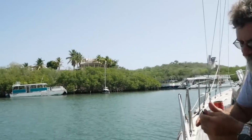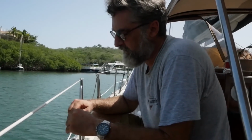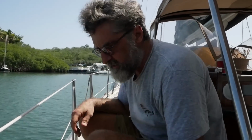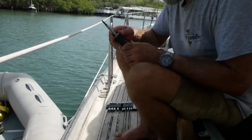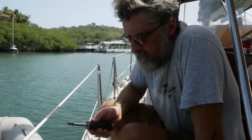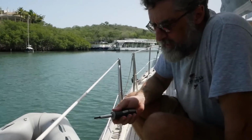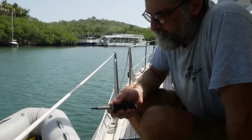Adjust that little valve, that needle that I was messing with, because I got it more or less right. What you do is you take this, you got to turn the engine and look in there. And you want to tighten. If you loosen it up, it's richer. If you tighten it down, it's leaner. So we want looser, it sounds like.